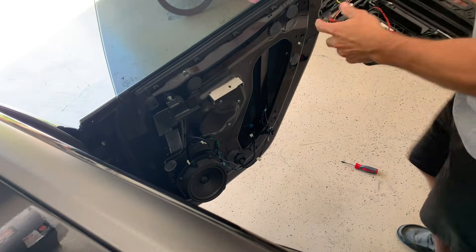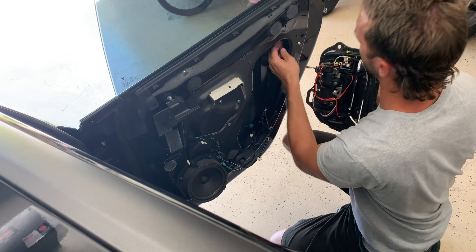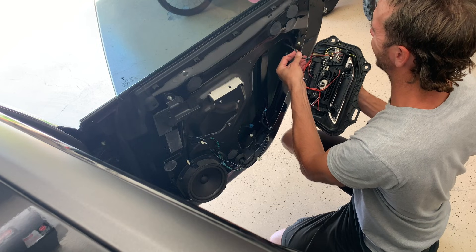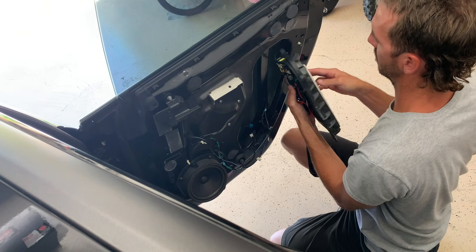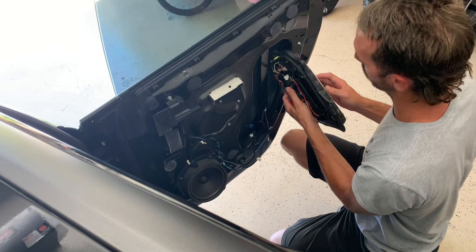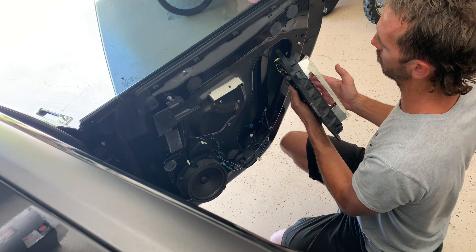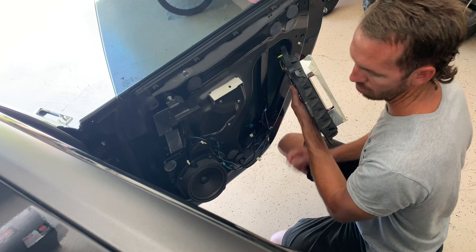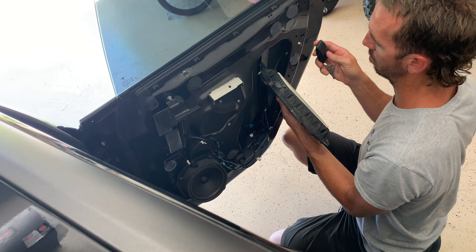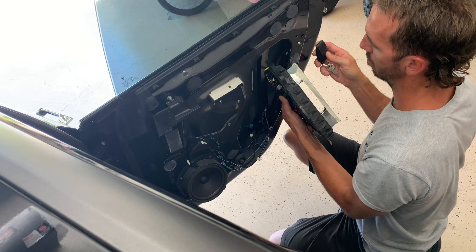Here's a problem you may sometimes have: if you energize the handle, it'll be pressed out, and when you go to put it back in, it'll be stuck out and you won't be able to slide it in. So if you just plug the door handle in, you'll see it will retract. I'm just testing it — make sure it goes in and out. Lock it, unlock it. You want to make sure that paddle gear is not getting bound up or in the wrong position.